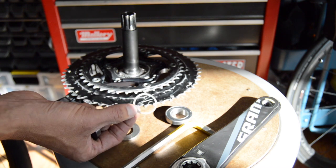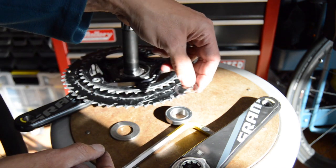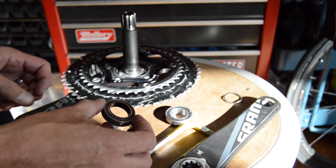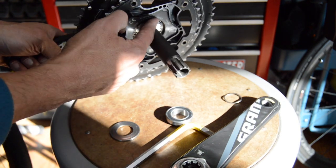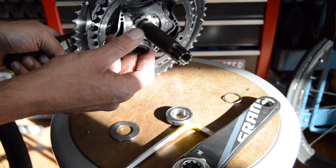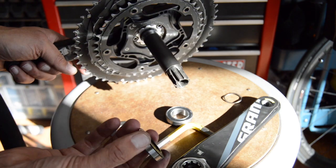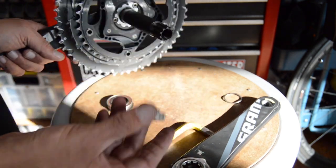My thoughts on the wavy washer are just, yeah, you just want to ditch this thing. So yeah, just take that out of the package and throw it as far as you can. And what I like to do, we'll get into this, kind of the fit up, is just fill that void if need be with smaller shims till you get the right spacing. I don't know, requires a little bit of experimentation, but that actually, in my opinion, works better.